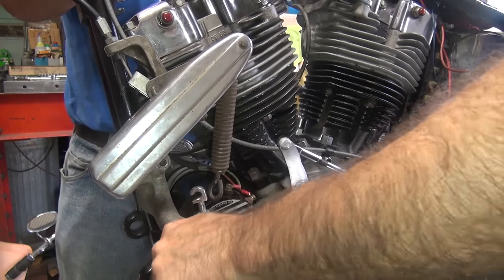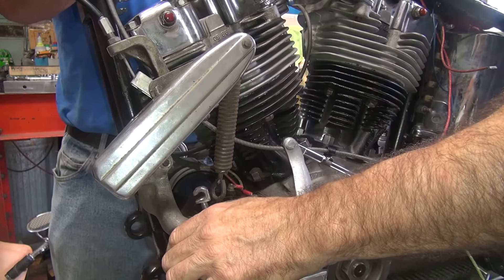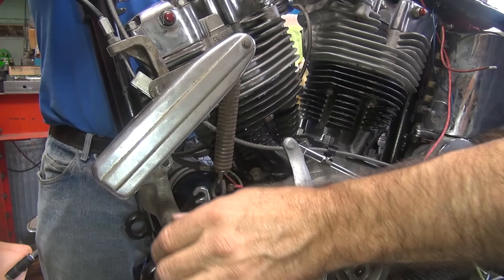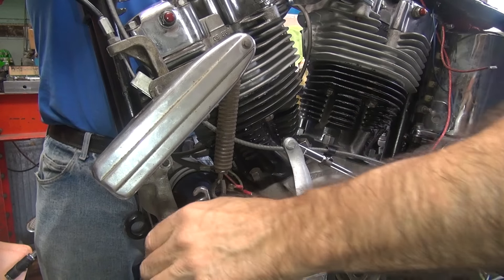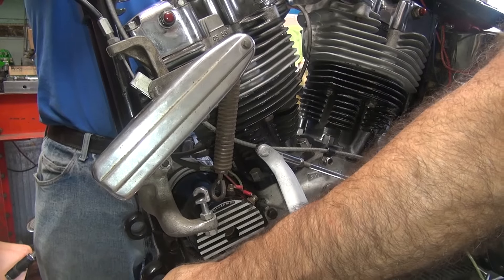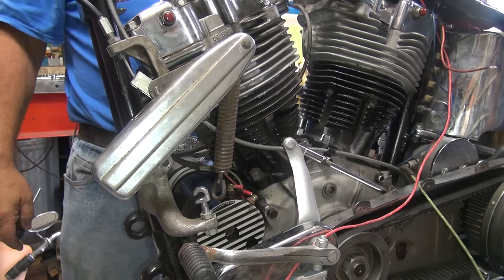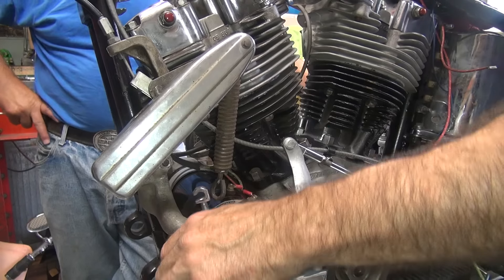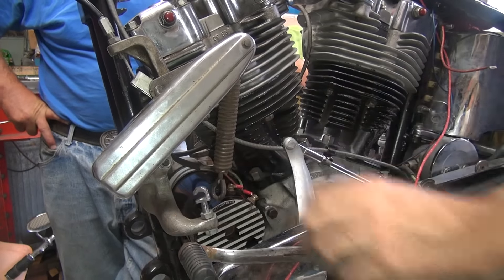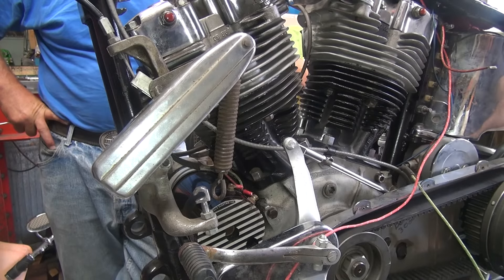Drifter's going to hit still. Does it work? That's the next question — does it work? That's all the way up. There's neutral. Second, third, fourth. So it has a reverse shift pattern in this bike. Yes it does. No wonder I couldn't find neutral — I kept doing the standard. It's set up for racing. I told you it was a drag bike. Pound on that sucker until it shifts.